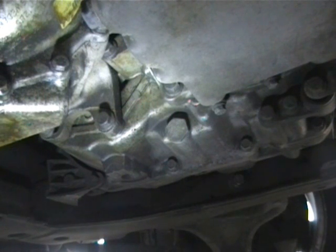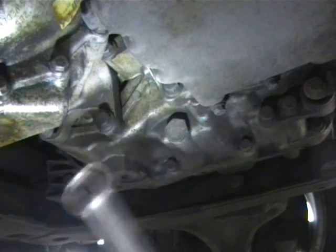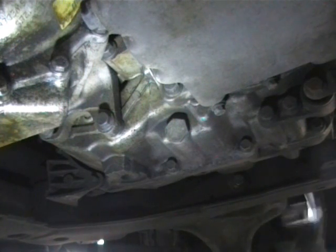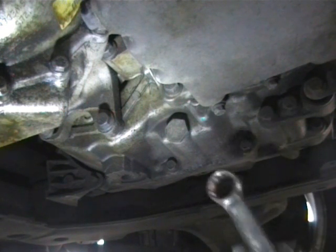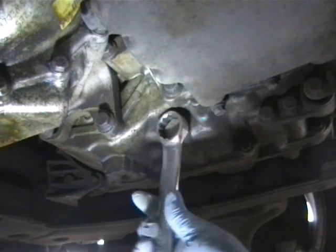Right, so now under the vehicle, and looking at the gearbox here on the left hand side of the car, as if you were sitting on the passenger seat, is the gearbox. Before you get to this point, you may need to take off an undertray, 4 to 6 bolts holding that on. I think they're a 12 or 13mm head. Drop the cover down, and then it exposes the underside of the engine and the gearbox. We've got a 24mm drain plug here,